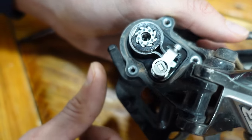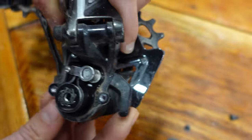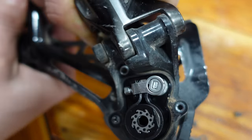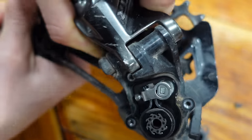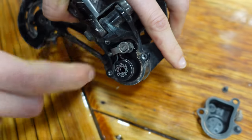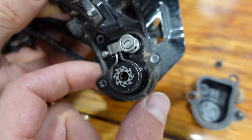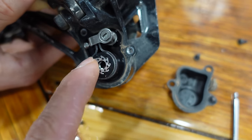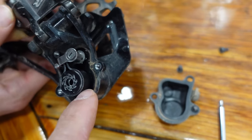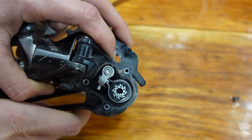Let's look at it and see how it works. The clutch is off — leave it off and move the cage down. See how it's twisting the inner thing each time you do that? Now let me lock it — see how much harder it is. Basically this little piece right here is getting squeezed. And when it squeezes on here, it makes it harder for that inner part to rotate. It's also harder than usual because it needs this maintenance — there's grease that goes between this outer plate and the middle, and it's very much not greased.